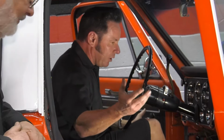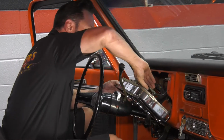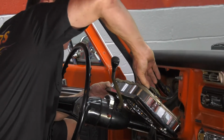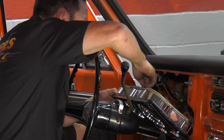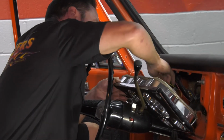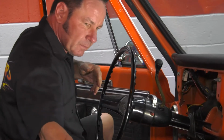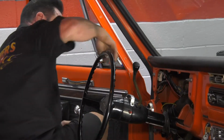And then once that's all done, we'll get this thing on the table and show you how to do the tach conversion. You're gonna reach up under here. Your oil pressure gauge in these old vehicles is gonna be mechanical. It's gonna have a hard line. Get a line wrench on there, take that out, reach up, unscrew your speedometer head, drop your steering column down to get it out of the way so we can pull the panel out.